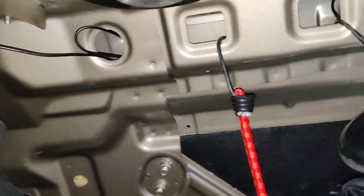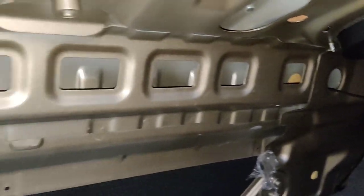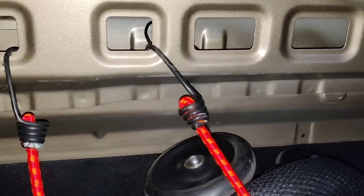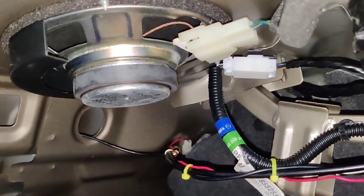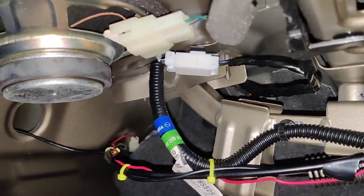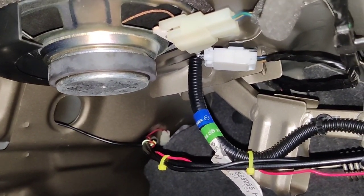From the rear end, I pulled the wire out from here. The proper route goes through the driver's side, then along the right side of the car — it's much closer. The red wire is responsible for the reverse camera signal. For that connection, I had to cut some wire from the reverse light and join them together.